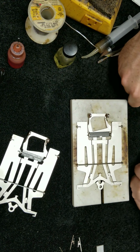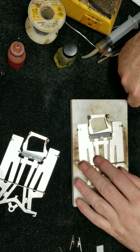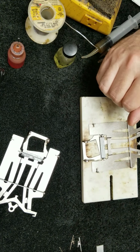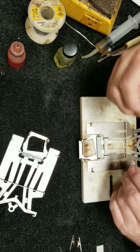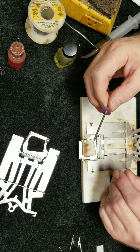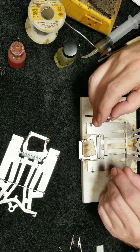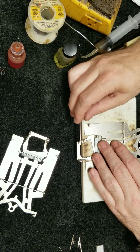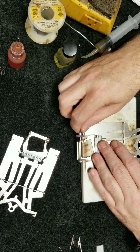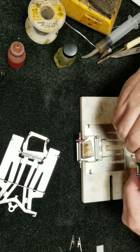So usually what I do next is I will go ahead and put the motor in. Now, everywhere I race now I use 64 pitch gears, but the same thing applies with 72 pitch. You want to take the smallest spur gear size that you're going to run, and 35 is about as small as I go with 64 pitch. I know there's some 34 tooths out there, but I go with 35. And we put that in like that. And of course, our motor, we're going to go ahead and put in.